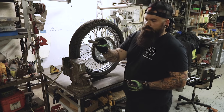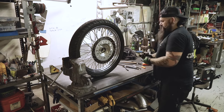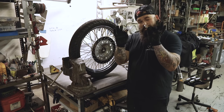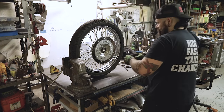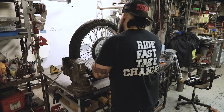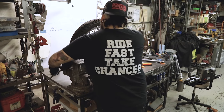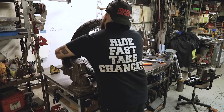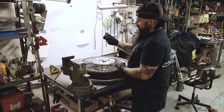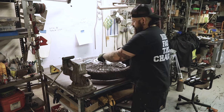You're going to have your stock spacer in there — it looks like that — just pull that guy out too. In your kit, you're going to get two bearings that look like this, and you're going to pop these in to your wheel. Helps to have just a socket. They actually make real tools for this, but this will work for our purposes right now. So get one of your bearings in first.